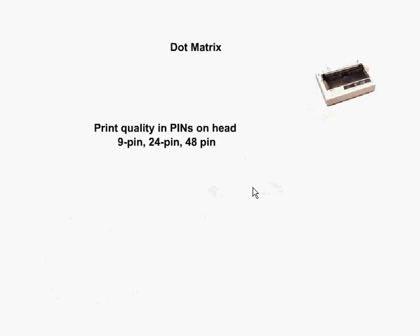The reason that dot matrix printers are in the impact category is because they actually impact the paper. The way that it works, it fires a series of pins at a ribbon, which make contact with the paper and leaves a mark. The print head contains a series of pins which move left to right across the paper, line by line, creating letters out of circular dots of ink that have impacted the paper. Pins shoot forward and strike the ribbon, causing the impact motion.